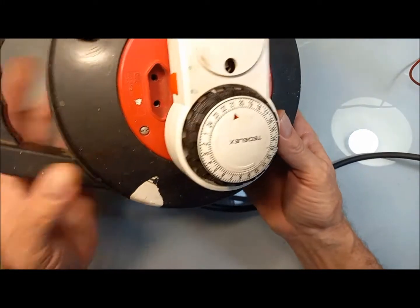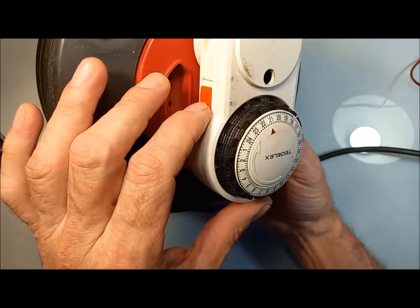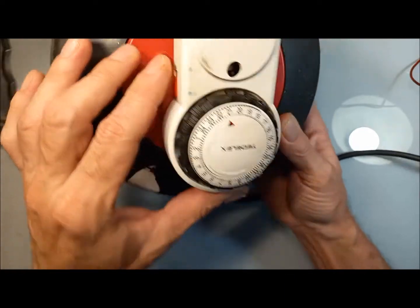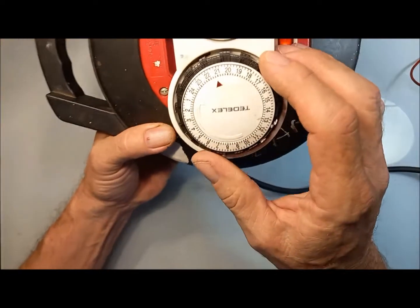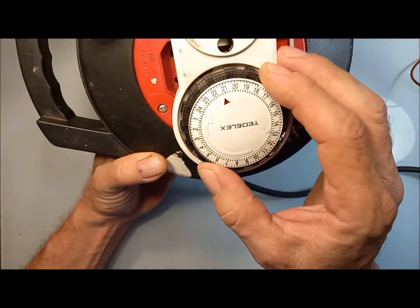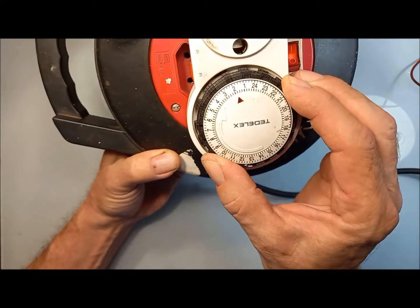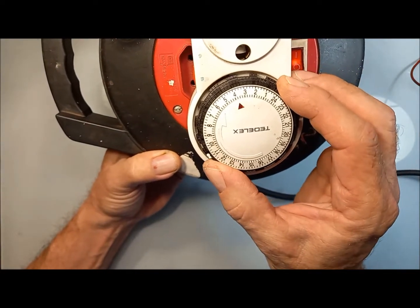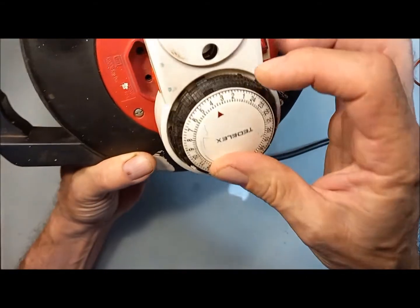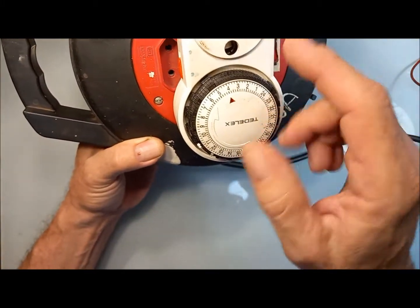At least the motor is running. This is just the override switch, as I say. If you want to bypass the dial, then you can override it here. Then it's on permanently. So this is just an indication here, like a divided clock, and then you turn it, like for 1 o'clock, and then it starts running, and every hour is exactly synchronized like a watch. Whatever you push over, when you push it down, that little indicator will then lift and then put the micro switch on.